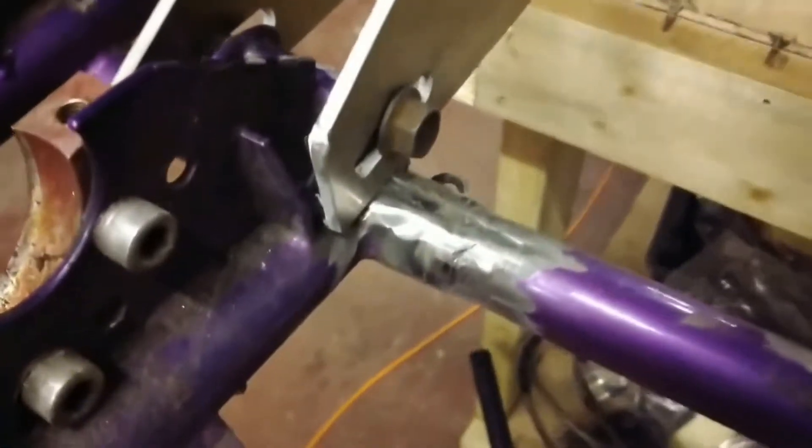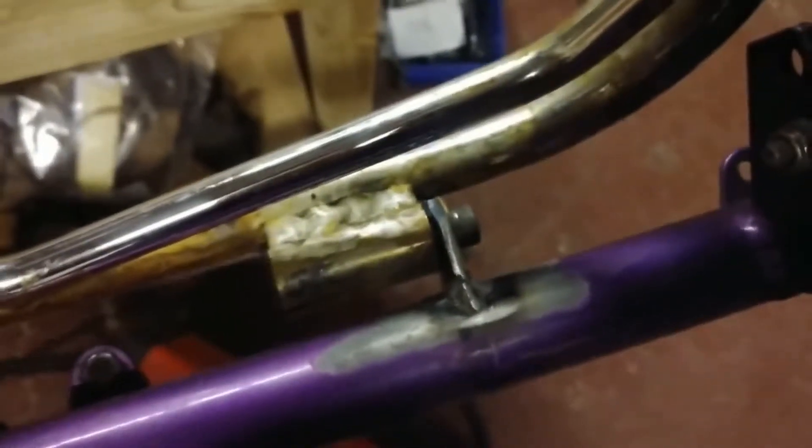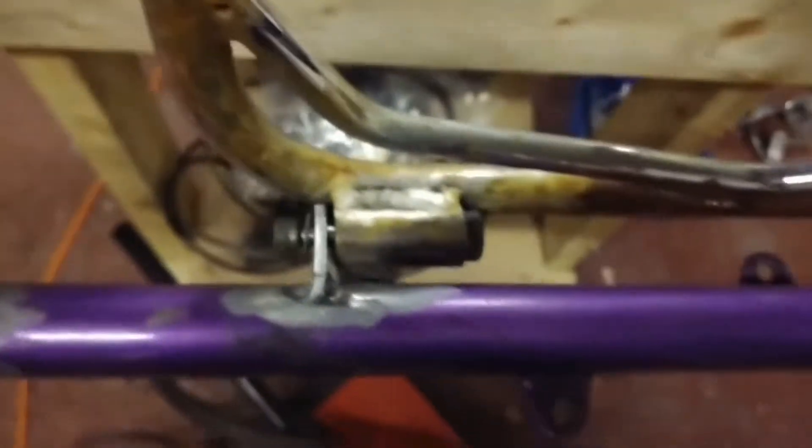All that was cut away and re-welded, all done and sorted. We adjusted the engine mounts and the engine cradle to fit as well. We've also added the seat housings, which have been completely custom fabricated out of just sheet metal - three millimeter thick sheet metal - so absolutely all sorted on that.